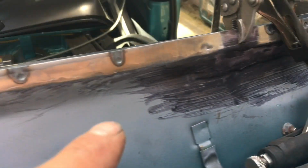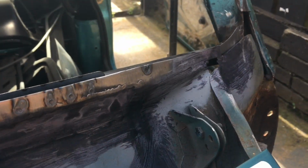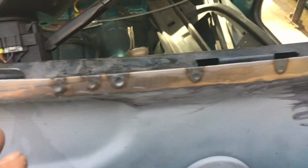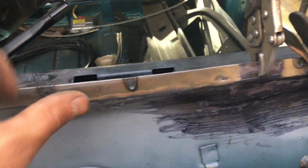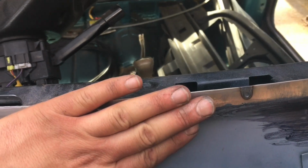So you can see from that quick time lapse that I've started to get spot welds all the way along. I do love that machine, it makes life so much easier. So obviously going to keep going. It's all about keeping the metal clean, and you can see points where I've got to clean it back a little bit further, but the finish is so much nicer. It doesn't even need grinding or anything. And obviously we're going to have another panel up against that, so yeah, really happy with that.